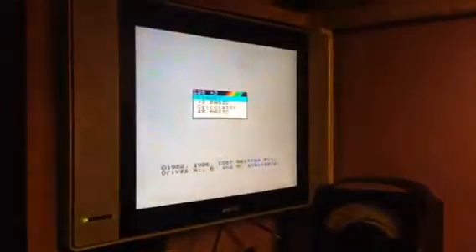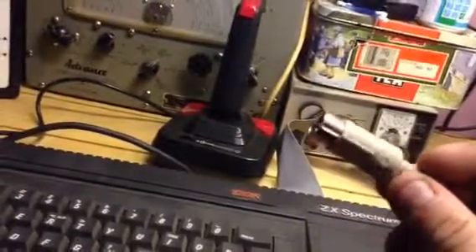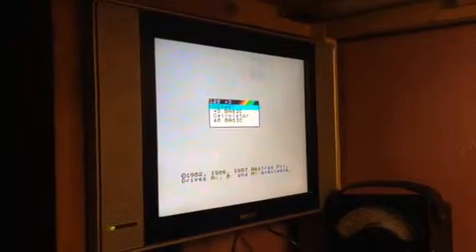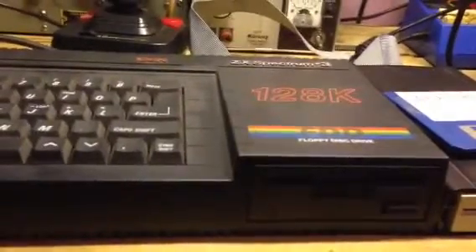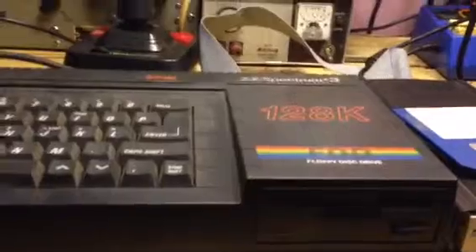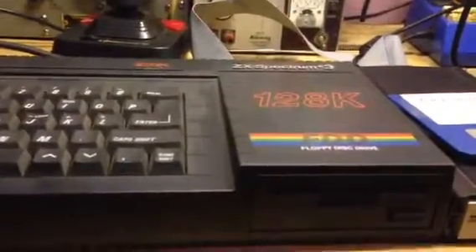Bear in mind I haven't made an RGB lead for this yet — I've just found a DIN plug which will suit the Sinclair and I've got an old SCART cable I can hack the end off and wire on. At the moment we're running on RF — it's not a horrendous picture for RF, it's enough to demonstrate this anyway. So the Sinclair works. The three inch disc drive doesn't work — as usual the belt's gone and turned to goo. I've got one on order to reinstate it. For now I've just disconnected the internal three inch disc drive because when you try to access a disc the motor just spins and makes a right racket.